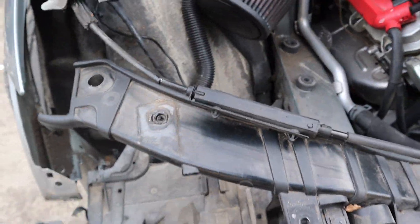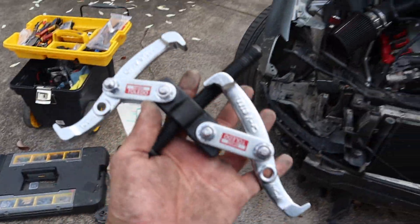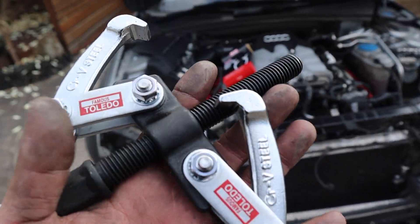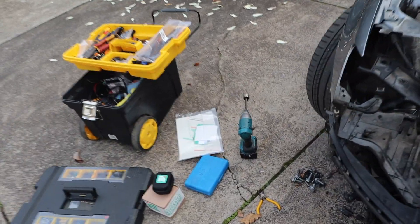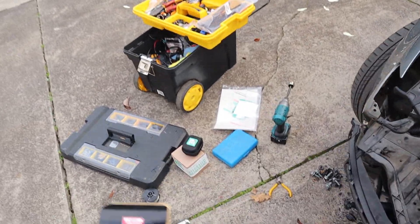I removed the headlights as well — they were pretty easy — and popped this down so I could use clamp puller things to get it off. I wouldn't recommend using those though. Whether you go Integrated Engineering or any other brand, they all have their own supercharger pulley removal tools which clamp around the supercharger wheel and pull it off, which is 10 times better. I had to drop things down further than normal just to remove it, so it's up to you — it wasn't too bad, but I pull stuff apart every day.